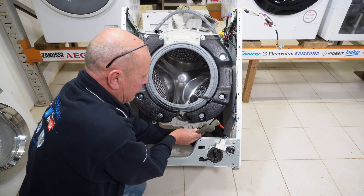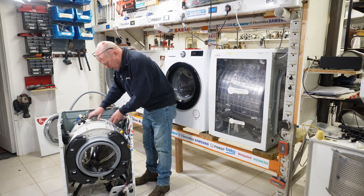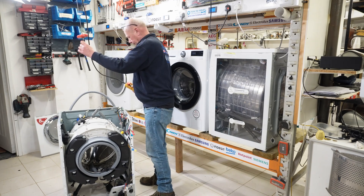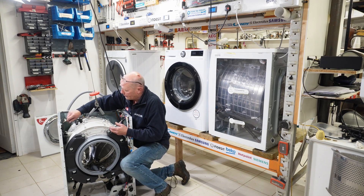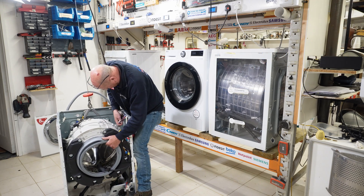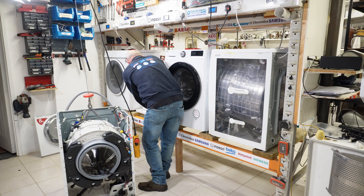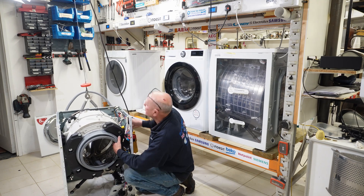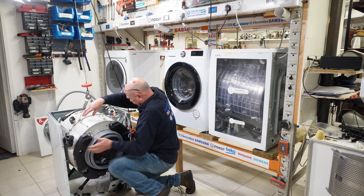You now need to cut off any of the clips that hold the wiring in place, and there is a screw underneath. At this point we're ready to lift the drum out of the machine. I work on my own and I have a hoist system which I use. Once you've got the tension off the drum, take out the locking tabs that hold the suspension legs in place — lift these up slightly and take them off the chassis. Then remove the springs off the drum to get them out of the way, make sure you take note of which way round they go. Make sure nothing's catching, and then carefully maneuver the drum out of the cabinet.